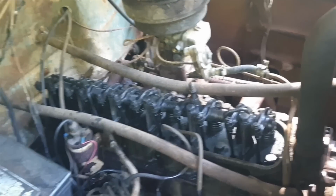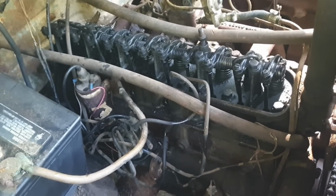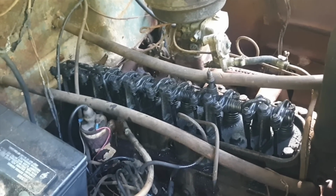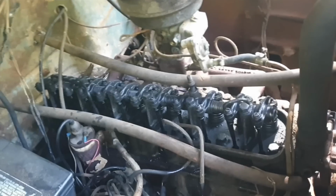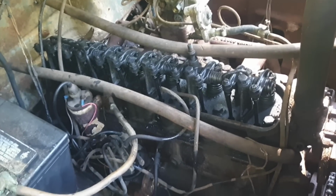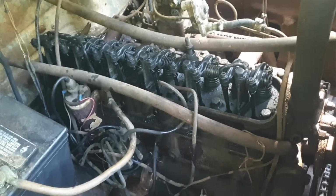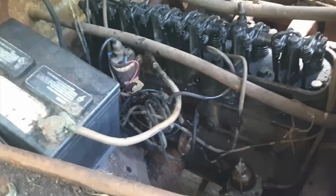At this point, I know it's not a valve, it's in the cylinders. And being that it's in the cylinders, it's just going to be a slow go until I push the rings through that rust. And I'm going to have to work it back and forth to do that. Time and patience. And time and patience is not going to make for a good video. So, I'm going to get some help and break her back loose, and I'll work it back and forth and get it loosened up, and then I'll bring this video back. It'll probably be a part 2.